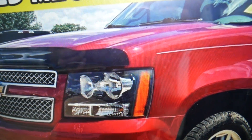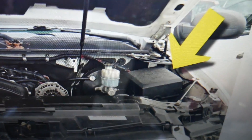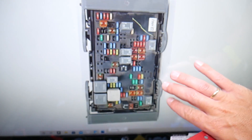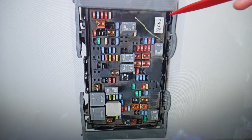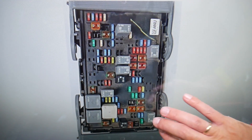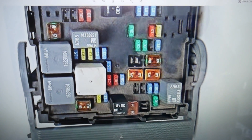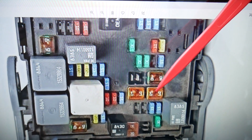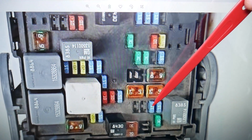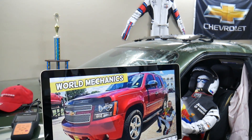Then pop the hood open. Facing the engine on the right side, you have a fuse box under a cover — open it and you'll find the fuse box layout. This is towards the front of the Chevy Tahoe, windshield side, between the driver side and passenger side. In this corner, you need to find fuse 45 — that's a 15-amp fuse — which you'll also need to check. If you have any questions, don't hesitate to let us know. Thanks for watching, and see you next time.